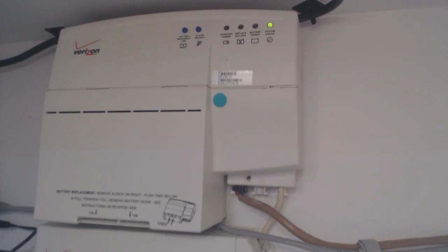Since I really wanted to back up my internet more than anything else, especially since I don't have a landline any longer, what I've done instead was remove the battery in this unit and connected the unit itself to a standard UPS. I'm going to show you next how the battery is removed, how I silence the alarm, and how I connect it to the UPS.